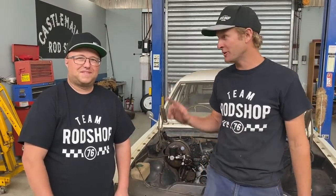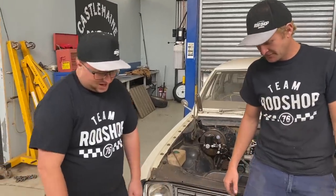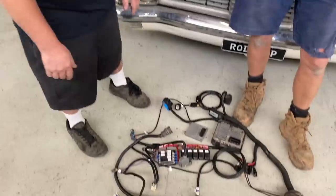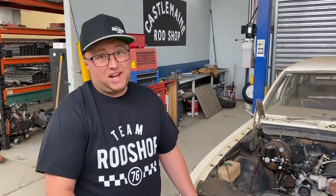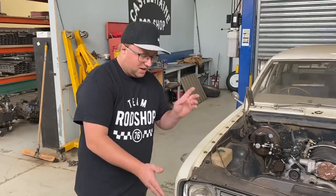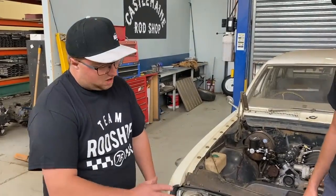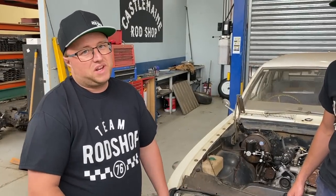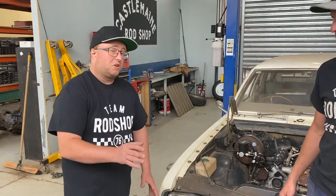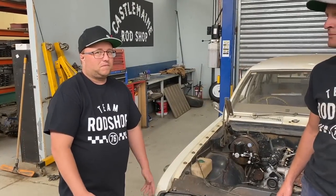It's wiring time. Now with me is the Rodshop wiring guru, Jake. So basically here we've got a VZ 6 litre auto wiring harness. What I've done is stripped all the wiring out of it that I no longer need. I've made it a standalone setup. All the relays and fuse boxes are there. That's all going under the dash with the ECU. I've reprogrammed the computer to suit a standalone setup, removed everything that would throw error codes up. So basically it's just got a start-up tune in it.